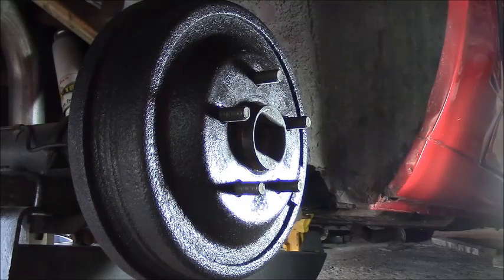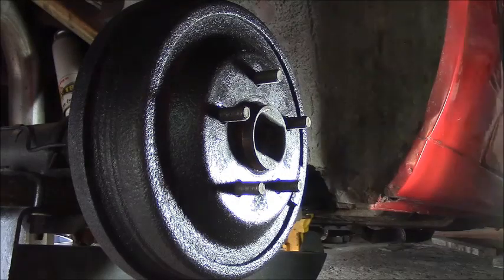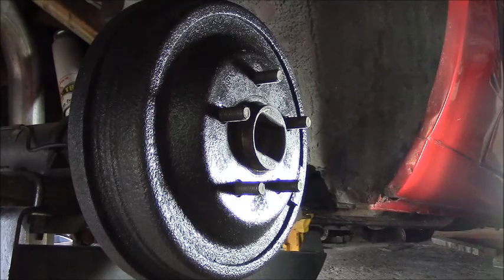So now the job is done, other than I have to put the oil in the pumpkin but I gotta wait 24 hours. I don't know how much I missed because the camera had gone dead. So I'm gonna have to put the oil in the pumpkin - five pints it says. I wanna lube my universal joints and put the wheels back on, but you don't need to see me put wheels back on here.